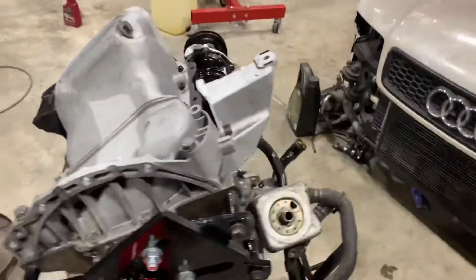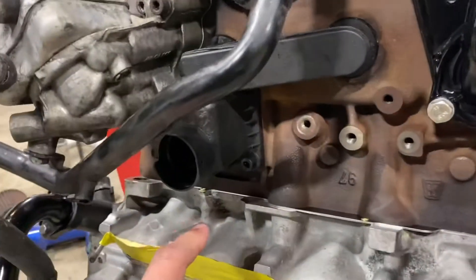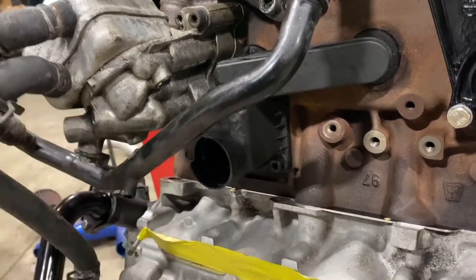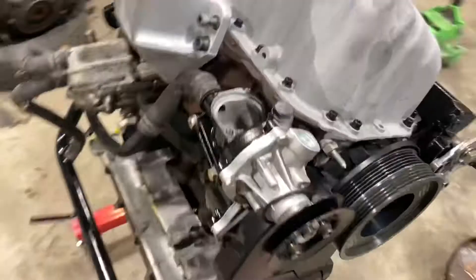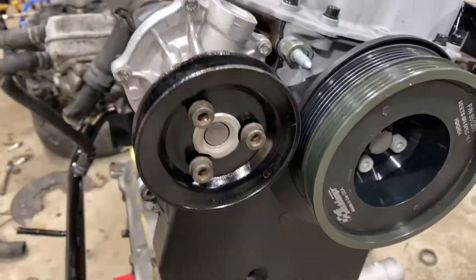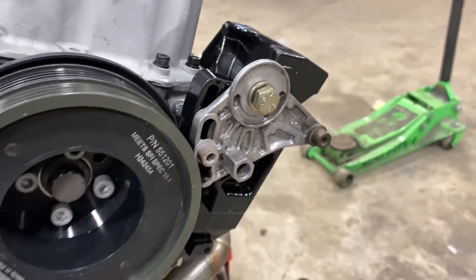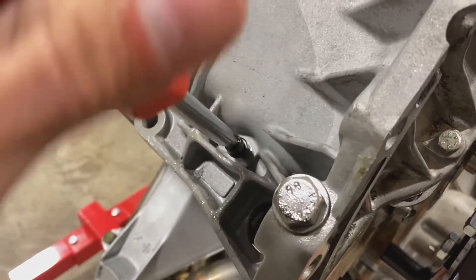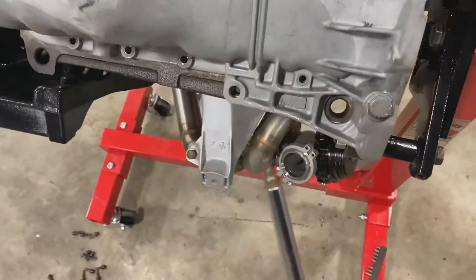The rear main seal went in the other day as well, so things are almost sealed up. I threw this stuff on just to mock it up and make sure I wasn't missing anything. This piece is going to get converted to a -10 AN fitting and then run to the catch can — and it looks like mine's cracked, so I should probably buy a new one. Water pump is on; I spray painted the pulley just so it looks a little fresher. AC tensioner — because I am going to be running AC — and the fluid damper. I was working on Dylan's car yesterday and left all my tools at my house, so the oil pan is coming off one turn at a time with a screwdriver.